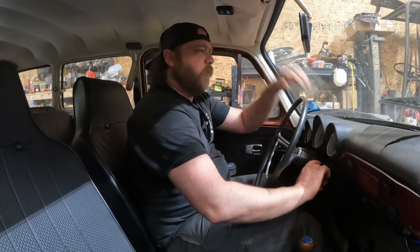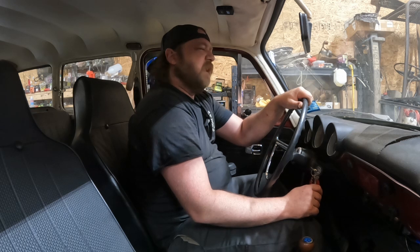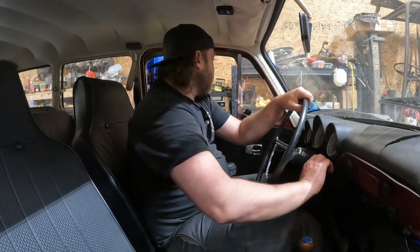I also adjusted the timing when it came in here. I think the owner said he felt like it was overheating. The timing was about 2 to 3 degrees more than I wanted on it. Don't know why, but I backed it off some. So let's try it again.